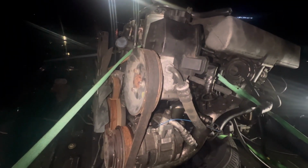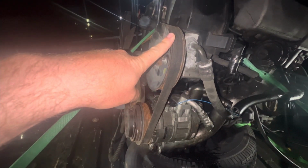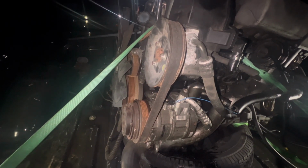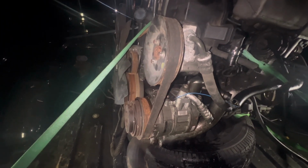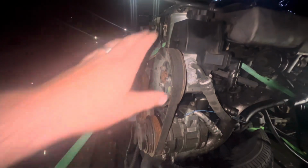Power steering pump, I'm going to check out the pressures, see what this thing's rated for. Should be just fine. I would imagine the C4 is a lot lighter than the 99 E300D this came out of, just given the fact the C4 is 90% fiberglass, I would say. So the weight should be less than the car, so this should be plenty good. We'll just get an adapter that'll go in there, hose this to the steering on the car, some new radiator hoses, oil cooler lines. The fan is extremely tight on this thing. I never realized how good they designed that.